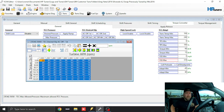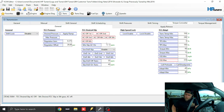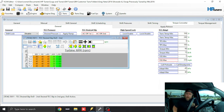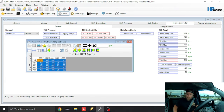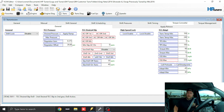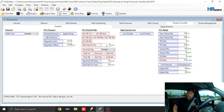We're going to disable that slip. Go to AC Off, click top-left, type in zero, do this for all of them. Same with Minimum Slip AC On — zero it out. Next, Use DOD Slip — we're going to disable it and zero all of these out too. Stock tune was allowing 40 RPM slip, plus another 20 RPM AC Off — that's 60 RPM of slip total. Factory torque converters are actually amazing; GM just runs them ragged with their factory tuning.